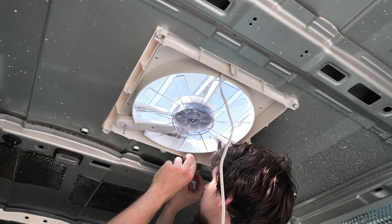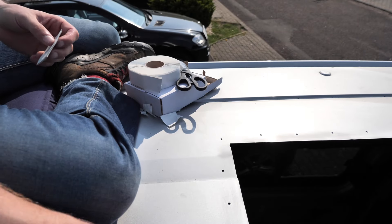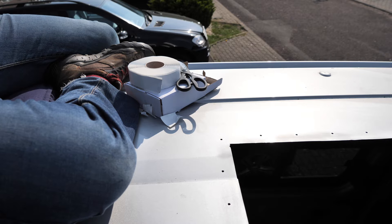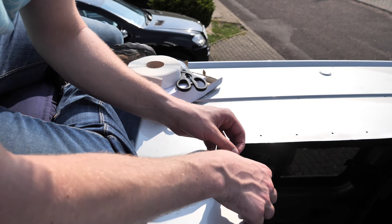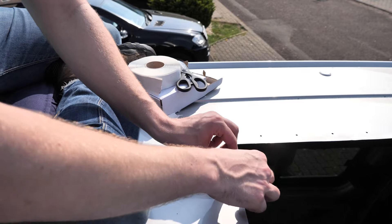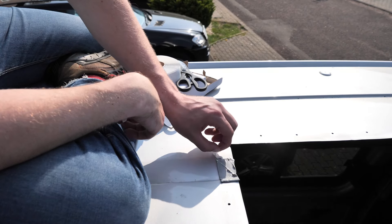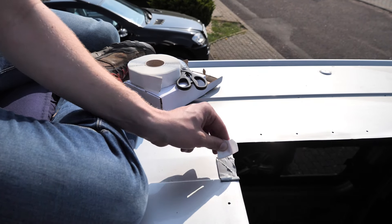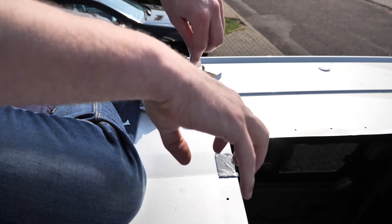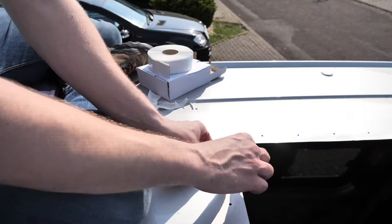Is it perfect? No, not really. But there's plenty of flange. So this next step is to mastic everything in. As you can see, I've got these ridges in the roof of the van, so I need to make sure that these are watertight for the flat surface to go on top after. Now, this is a bit of a bugger — you have to excuse the ludicrous amounts of swearing. Simply putting it down and peeling the paper off is not as simple as you'd wish. The normal advice is to push it down quite hard to begin with, but I just can't do it and get the paper off at the same time. So what I'm doing is getting it off and then going back in with some pressure. I don't need to go nuts here because when I actually come to put the screws in it's going to compress it all down anyway. I want to make sure it's got a decent amount of contact before going any further. This is mastic — it's fantastic.